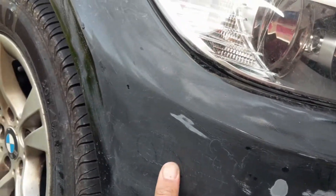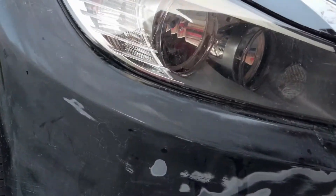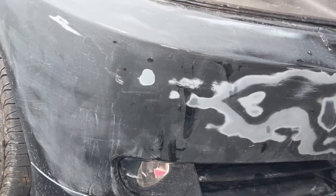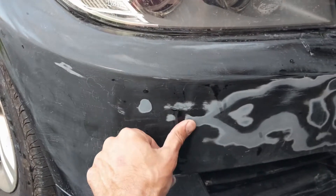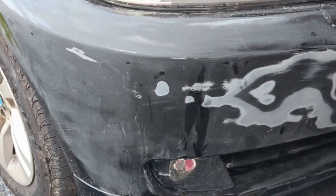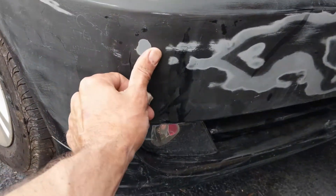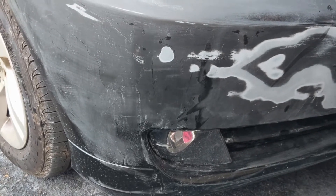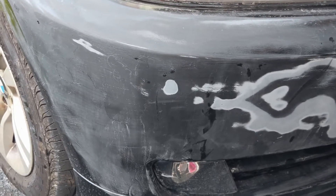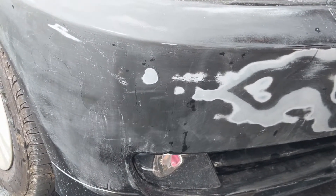Do I need some around here? I can feel it more — maybe I need to go down to 240, I'm using 320 at the moment. So we're sanding here. This bit's clearly okay, it's just in here we need to get rid of these hazes, otherwise it's just going to come out again. I suppose I could put some high build primer on there to build it up and do it that way. We'll sand a bit longer first and see where we can get to before we decide about that.